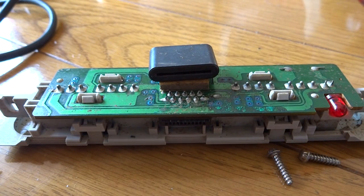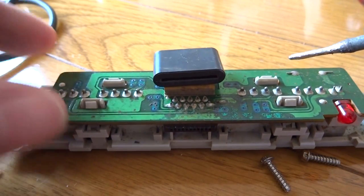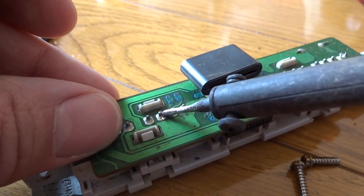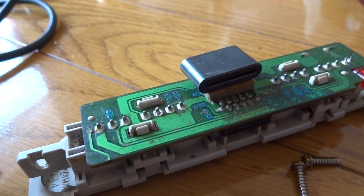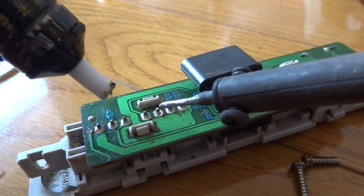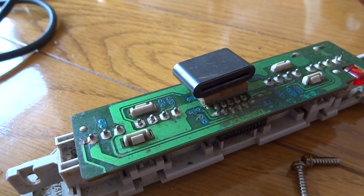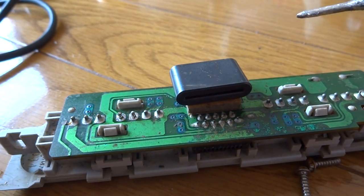As you can see here, we've got our controller port off, and it's gotten a lot of corrosion to it. The solder is also really, really dull. So we're gonna try and remove the old solder here, take the circuit board off of the back, and then clean up the pins and put down some fresh solder. It's heating up a little bit, but it's really, really crusty. We've got our solder sucker — we're probably gonna have to do this a few dozen times to get it completely off, just because it's not heating up very well. We might have to put some fresh solder on it just to make it flow a little bit easier. I'll go around all of these pins, take all of the solder off, and that should allow us to detach this. I'll be back in a little bit.